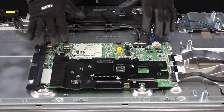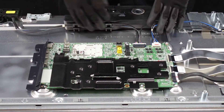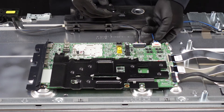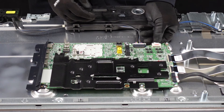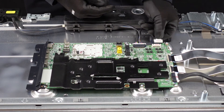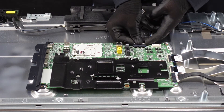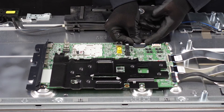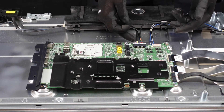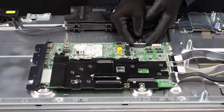First up is going to be the main board. There are screws fixing this into the back, but first we want to focus on the clips. A lot of them are going to be pretty standard — we've seen a lot of these before. This one you're going to want to depress with your thumb or thumbnail, which releases the clip, and you can just slowly walk that away from the board. This one's going to pinch down on the right and left side — same thing. Grab that clip and slowly start walking it out. We have one side that popped out and the other side's actually still affixed, so we're just going to plug the whole thing back in and try one more time.